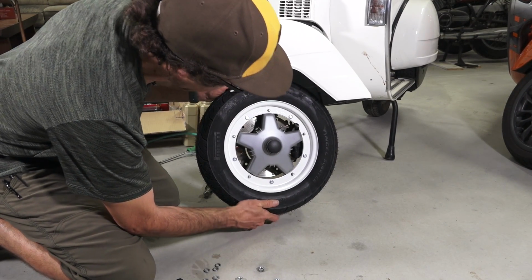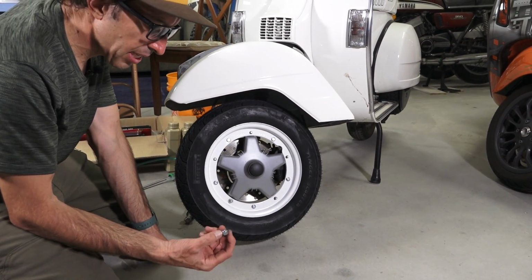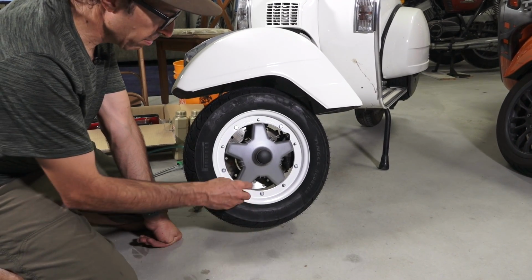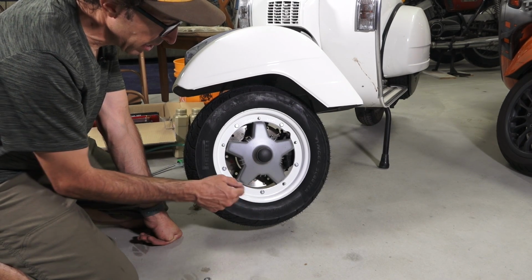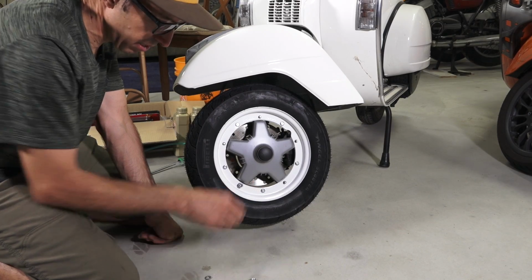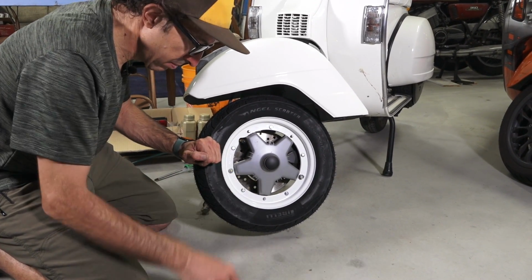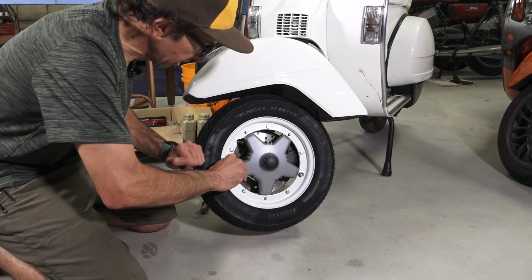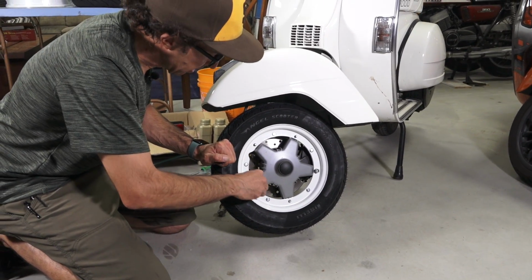And go ahead and line up the studs. And one thing about reusing these nuts, you typically want to look for the side that's already been up against the split washer, because if you have it the other way around, you'll end up with the zinc plating that's off the nut, and it's going to look rusty in no time. And I'm even putting the same nut that has the paint mark from the factory on this stud here.